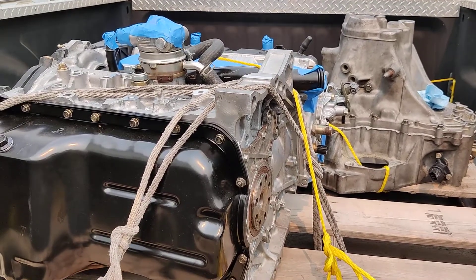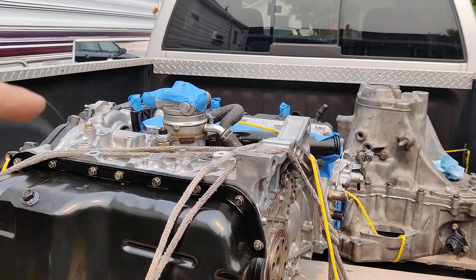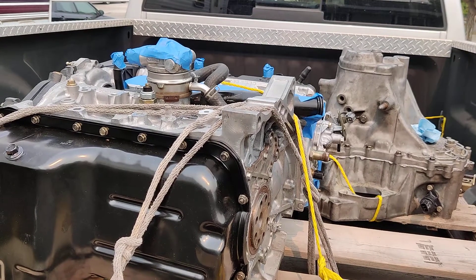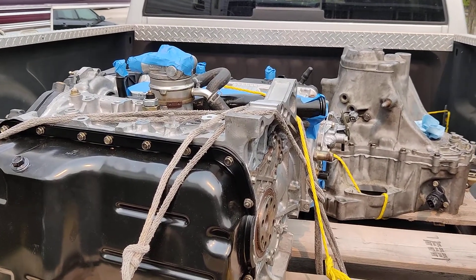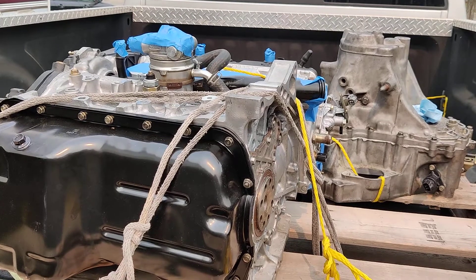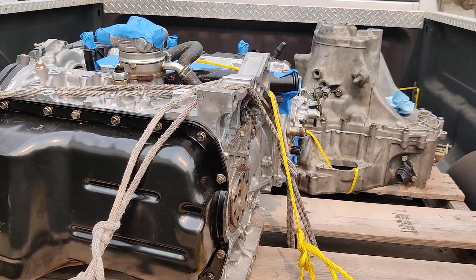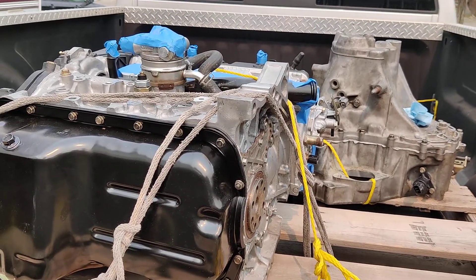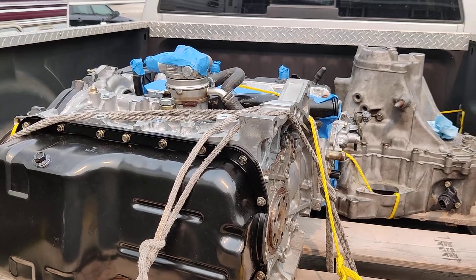Doing it the old style — no VVT, no crazy stuff on the valve train. It's simply cam gears, set them up, VTEC set it up, and tune as necessary. Now that I've done a bunch more of these it's kind of second nature — I know exactly how it should work. If you keep seeing these low VTEC engagement points, they're doing it wrong. You shouldn't even be able to feel VTEC. When you do the primary cam properly it comes on and you're hearing a note change, but not a power dip. It's going to be a really fun, rowdy car in a VX chassis — just the best little street beast ready for the mountains.